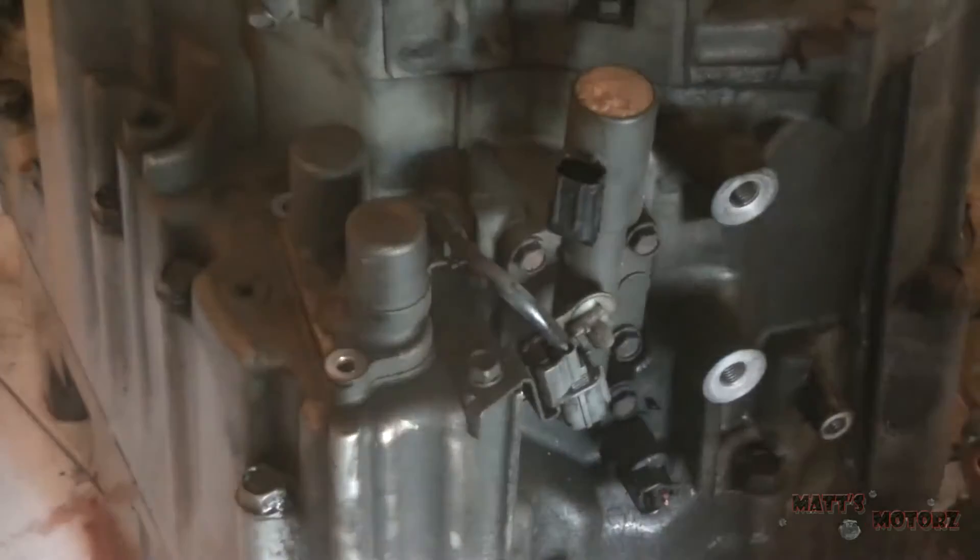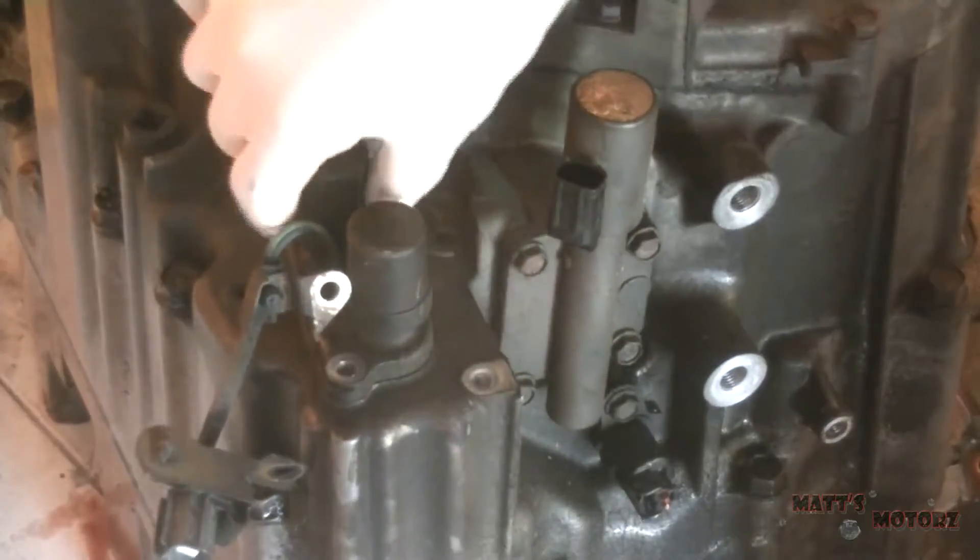This is the shift control solenoids, and they're all 10s. Threading the bolts back in afterwards so that I know where they go. It's always just a bit of practice to do that, especially when you're dealing with the transmission.